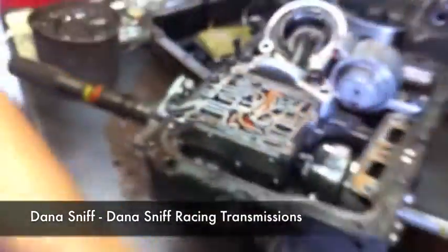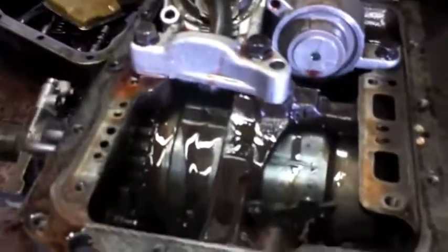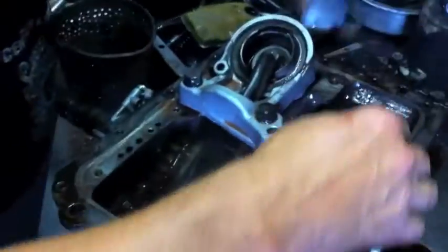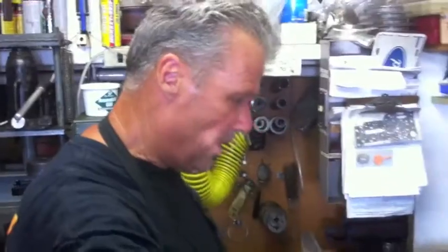Extreme Mustang Medic close-up — that's what we do. All this comes apart, all the valves that come out of that valve body. Make sure everything's nice and clean and moving smooth. A lot of guys will just wash these things; I see guys whack them on the table because the valves are iron but the bores are aluminum, and sometimes they get a burr. I'm guilty — I've done it a few times, but do it cleanly with the valves out of the bore. I'll give the bore a little polish and spin the valves at high speed — about 3,000 RPM with 400-grit paper — then put them back in the bore and give them a light slam. Once they move on their own under gravity, they're good to go.